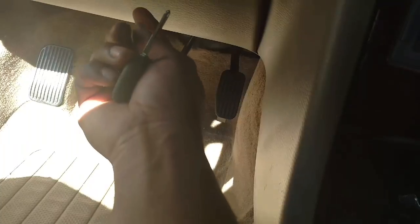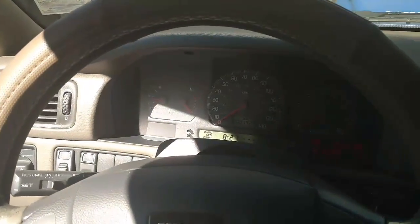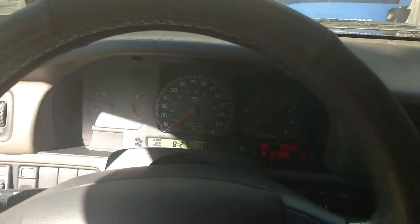Next, I'm going to pull this panel down here and unplug the alarm security box, plug it back in, see if it starts. I came up under the dash and disconnected this black box here. Plugged it back in, car still won't start. This next connector is normally clipped up higher. I pulled the plug on it, tried to scrape over the pins a little bit, put some dielectric grease on, plugged the connector back in, and I'm going to see if the car starts. Still no start.